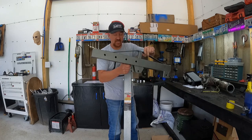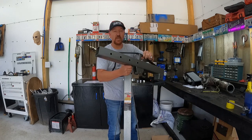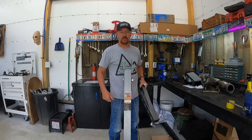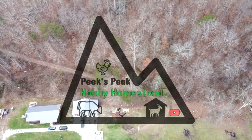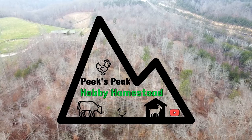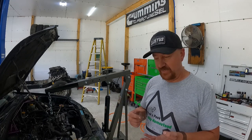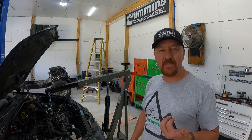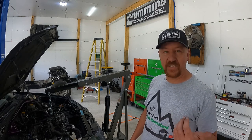That arm is not secured so be careful when you pick that up because it'll slide out the end. Gather up your tools: 24mm socket and 22mm socket, your impact wrench and ratchet, a 14mm socket, 14mm wrench. I didn't have the corresponding metric wrenches - the 22 and the 24 - so I used a 7/8 and a 15/16 wrench.